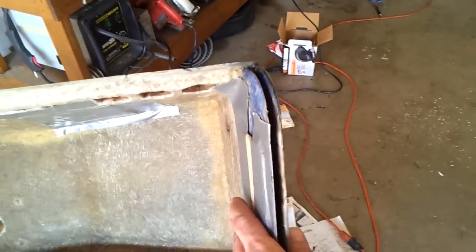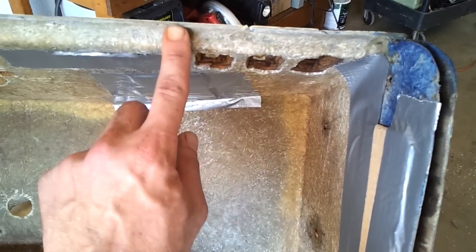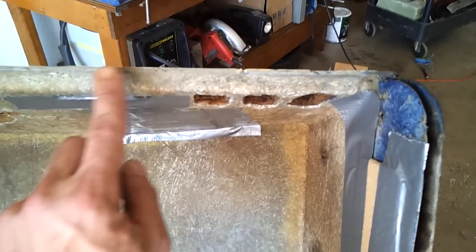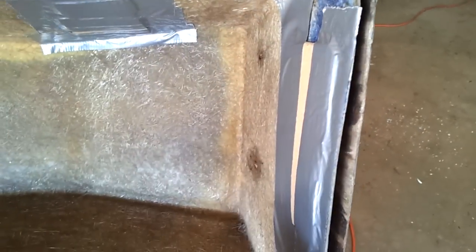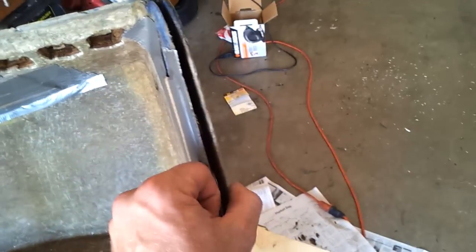However, along this side it did come apart and a whole bunch of that came out. This side panel here was completely rotted out, and you can see why — the way they tied this in here, they left a gap to create a seam to layer into the edge, but they didn't do that on this side. Both pieces of fiberglass come down to the same length and there would have been wood in between. So I've blocked off the holes here and here on this side.